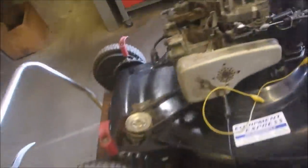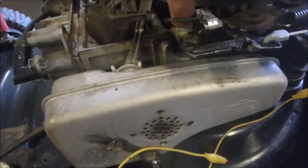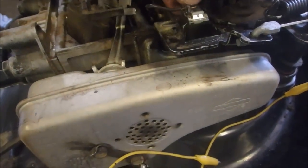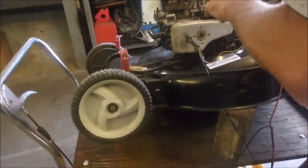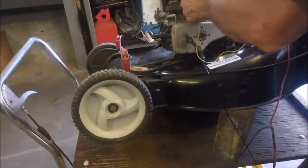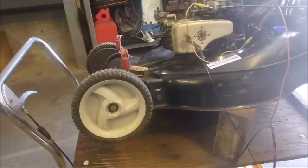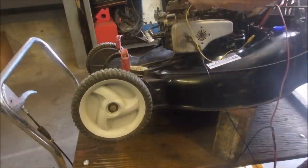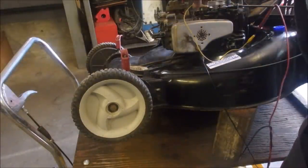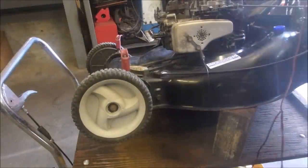So now what I did there was I just put the wire through there. Right there. You see it's wiggling? And we'll just do one more check electrically to make sure nothing's... Well, it's going to change because now you're measuring the resistance of the coil on that tab. Okay. 2.7 to 4, that's good. So I'm measuring 4 ohms on the coil, that's just fine. Okay, let's put this bad boy back together.